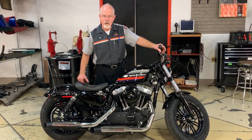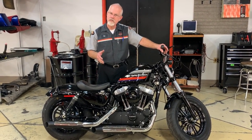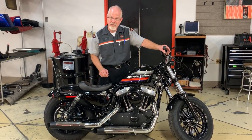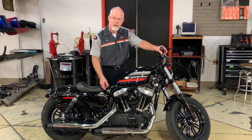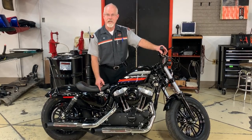That's why it's very important. No matter what Harley-Davidson model you have, you can check the oil and make sure that the oil is on the dipstick before you start in the morning, but don't add any oil until after you've ridden the motorcycle — maybe to the first gas station or maybe to work — so that you can tell that all the oil has been circulated in the motor and a good oil level is in the oil tank.